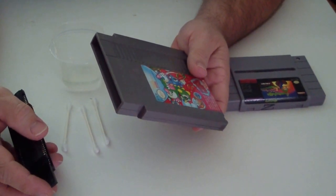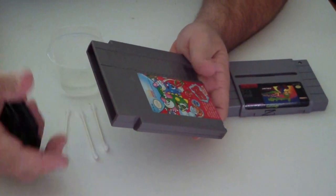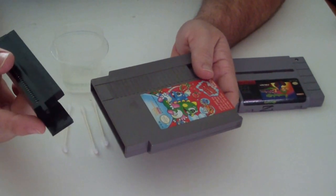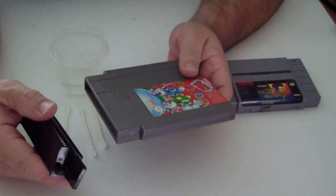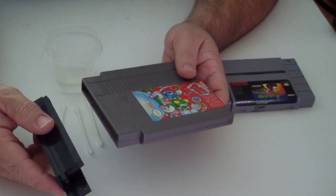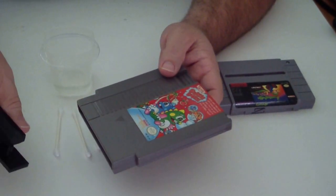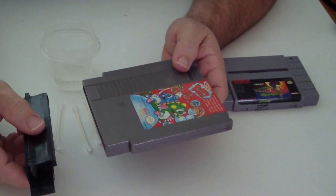To me, it's kind of like a car battery. You put your battery post on, it'll start corroding and eventually won't work. Same difference — this connects to your Nintendo NES motherboard, and basically if it corrodes, it's not going to get the information it needs to start the game. There's also the CIC chip, which causes a lot of blinking and blank screens. It's a chip inside the game and the system; if they don't communicate, it starts resetting because the system thinks there's an illegal copy of the game.